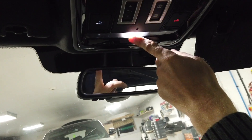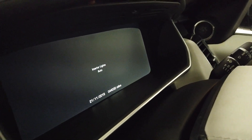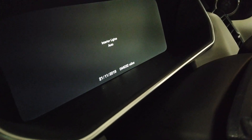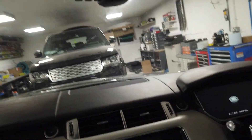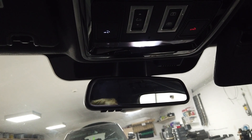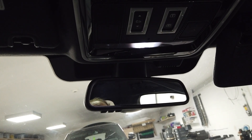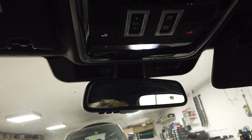There is a way of enabling and disabling it. Press and hold — watch the dashboard — and this light will flash. You get a double flash and it says 'interior lights auto.' Now when we open the door, they've come on. When we close the door and lock the car, they should fade and go out. Unlock the door and they come on again.